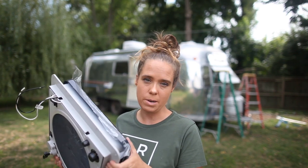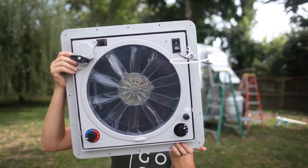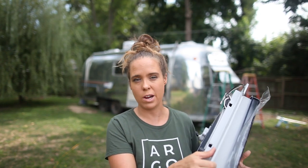The Fantastic Fan does come in a couple of options — a couple of different roof options. This one is somewhat see-through, which I kind of like. The last time I put one of these in, I did not go with this cover because I was afraid the black would look bad on top of the Airstream. But in hindsight, I wish I would have because I like it letting in a little bit of natural light. I also highly recommend going with the fan with the rain sensor. It's worth a little bit of extra money — if you're traveling and you leave this open during the day for your pets and it starts raining, it will close automatically. It's worth the extra money, it's worth not getting your trailer wet, so definitely add the rain sensor. It's a must-have.